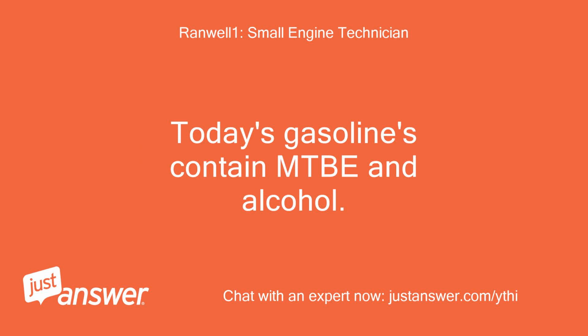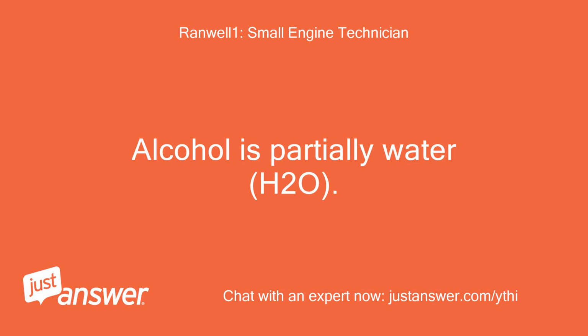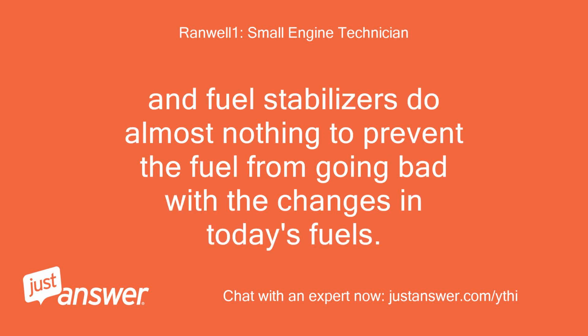Today's gasolines contain MTBE and alcohol, ethanol. They turn to junk and garbage very quickly. Alcohol is partially water, H2O, and they even call it oxygenated fuels. It is the oxygen that breaks down the organic compounds in the fuel and turns the gas to garbage, gum and varnish. The fuels we had just a few years ago had no alcohol in it and also other additives. It would store for longer periods of time before going stale. And fuel stabilizers do almost nothing to prevent the fuel from going bad with the changes in today's fuels.